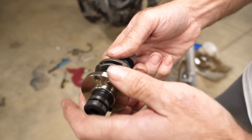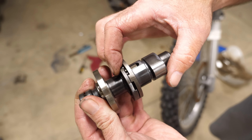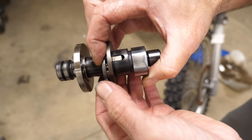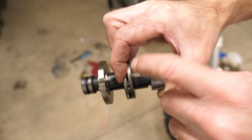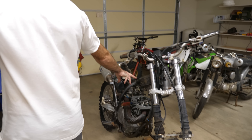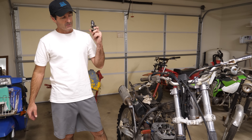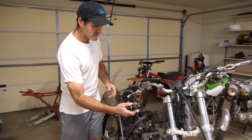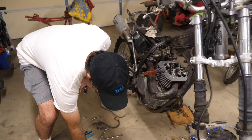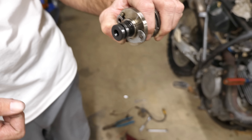This only acts when the engine is stopped or moving very slowly. As it spins up, there's an arm here that gets pulled outwardly by centrifugal force, flattening out the temporary lobe — pretty creative. The camshaft then operates as if that wasn't there at all. The cam chain was tight too, so that wasn't the problem. The last hope is maybe somebody installed the camshaft incorrectly and the valve timing was off by a tooth or two. There's evidence of this by the safety washer plate — someone's been in there before with their hammer punch.